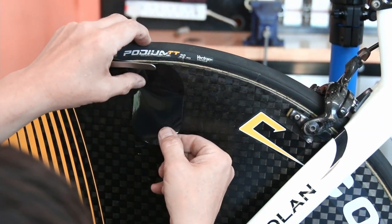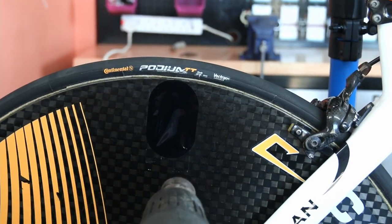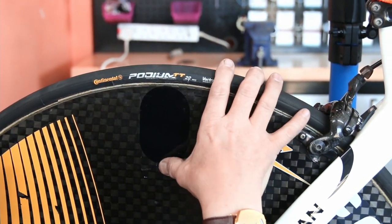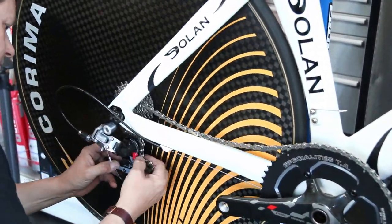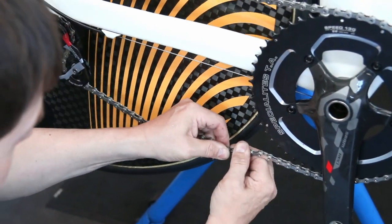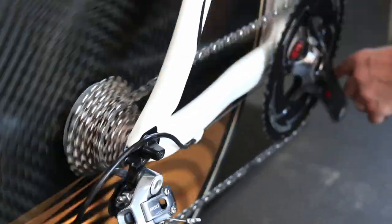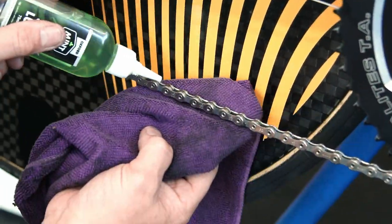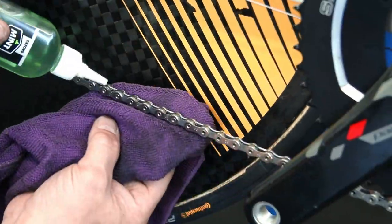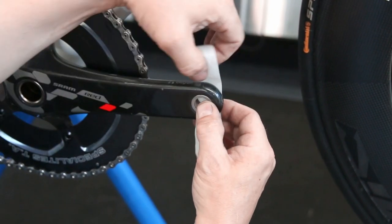Little details — I'm all about the details. So we just cut some ovals in a vinyl cutter; I've measured the hole size and we heat that up to shrink it on. A lot of manufacturers will sell you these in packets and some have plastic cups that go over, but this is an older wheel so we just cut them to fit. On goes the chain, and now we just check the indexing of the gears — this did need a little bit of fettling, it just needed sorting out and getting right. Once we got it right, we oil the chain, because I don't want to make the new cassette dirty.